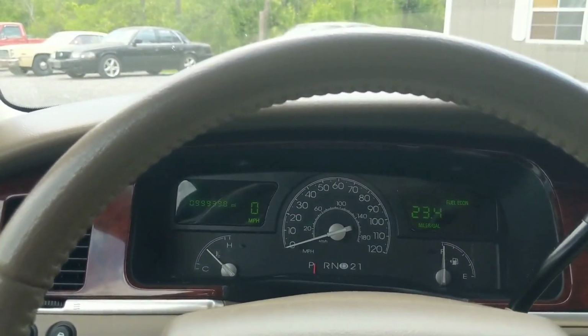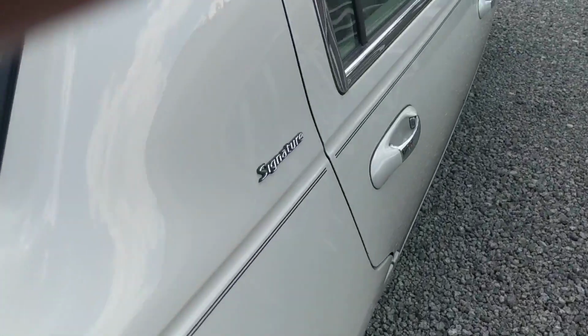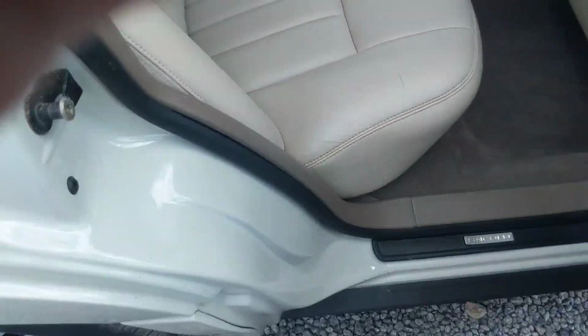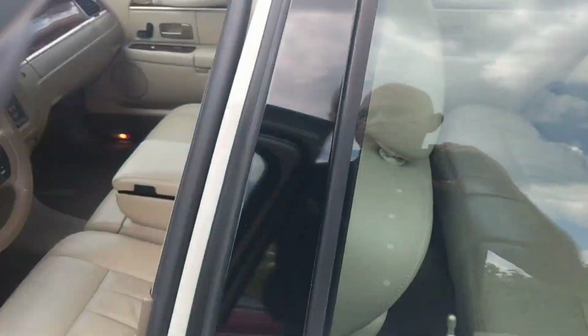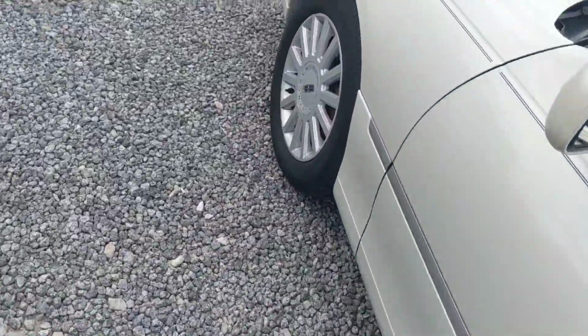They're notorious. If you get in the back seat on the passenger side and your floorboard is wet or actually has water standing in them, I've had them with 4 inches of water standing in them when I took them in, or people brought them in to trade in on another town car. There is a seal under the hood where your fresh air goes in, because these cars have a double floor in them. In the front end and the front seats, front floorboard is a double panel floor.